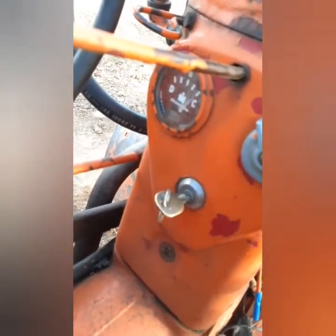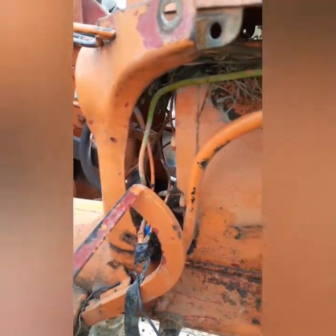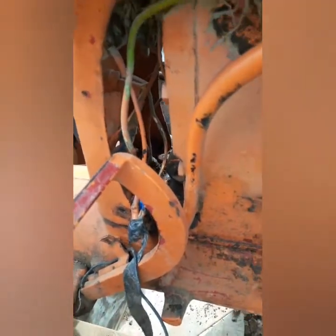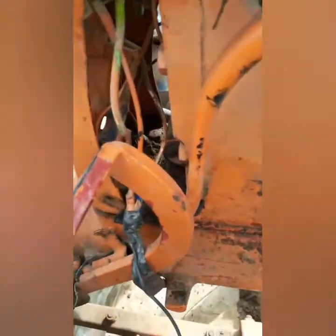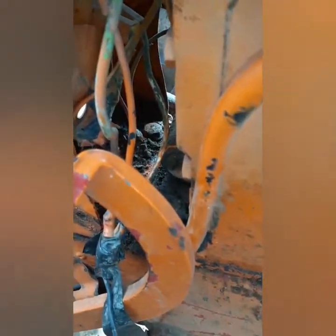Still jumping. I have to do some more research. All right, so I did some research last night. I might have the ammeter gauge wired up wrong. I have a rat's nest in here — look at this mess. I'm taking this off and just going to fix everything, clean all the ground connections. That's where one of the ground connections is — that's pretty nasty. I'll keep you updated on this.